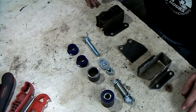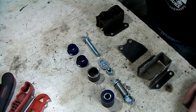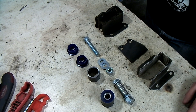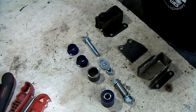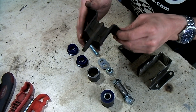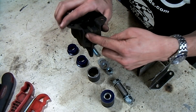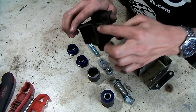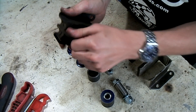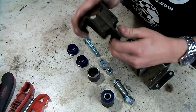Some of you may know that the original engine mounts are a very fragile design, and they're the same on the Lotus Elan. The twin cam engine cars have a lot more problems than the Renault engine cars because the engine is quite a bit heavier. This is one of the original engine mounts that came off of my car. This is in reasonable condition — you can see a small crack here — but when they're gone, the entire rubber fails, the engine mounts completely sag. You can get upgraded versions with the original rubber but they fail as well.